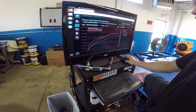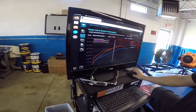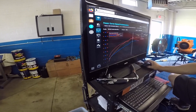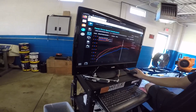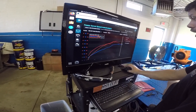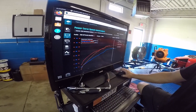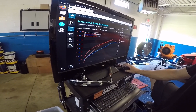Horsepower started picking back up but it cut out early on the RPM. We're trying to adjust that. It's probably some sort of issue with the tach pickup to the AEM. What we're doing is extending the RPM range in the software to see if that was the case. I'm going to increase RPM on the AEM for the limiter to see if it pulls past this point. If it still doesn't, it's possible it's losing vehicle speed to the AEM, causing it to trigger the two-step rev limiter and stopping it at 5100 RPM.